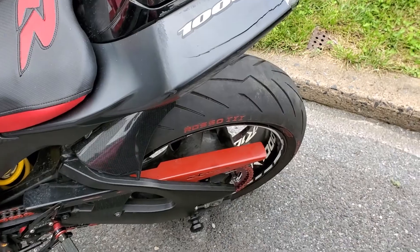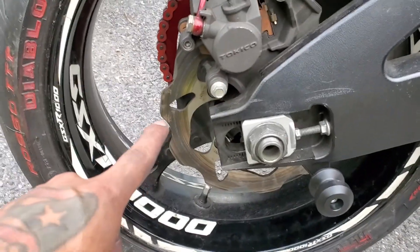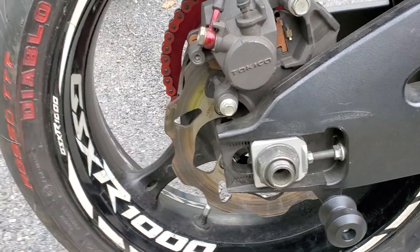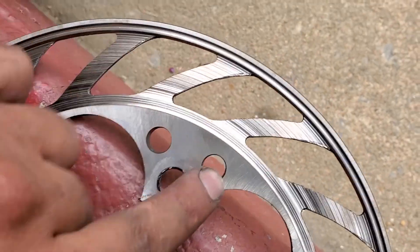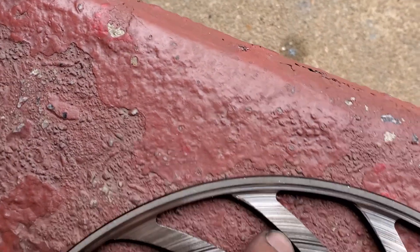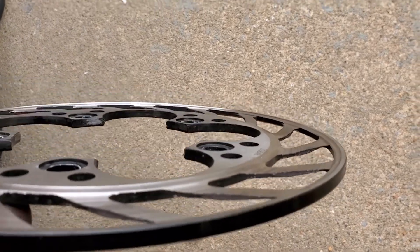It was a long day — I started from 8. I want to show you guys something. I had to put the ones I had on first back on, and I want to show you guys why. I'm afraid my pistons might be stuck for the rear brake. See if you guys can see that — there's a lip right here. There's two lips right there, and the rear is the same thing. I got lips, and these were about to break — you can see how thin they are, plus they're bulged out.